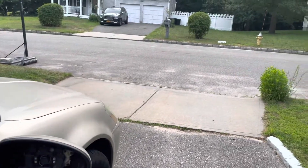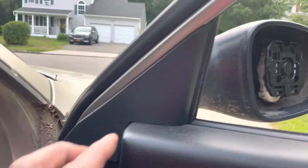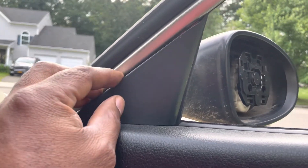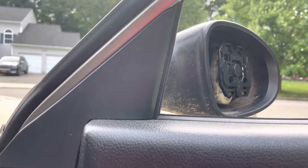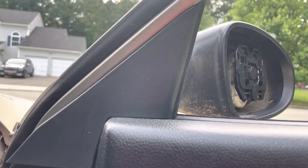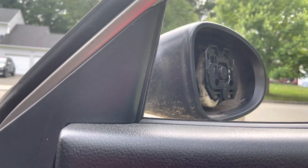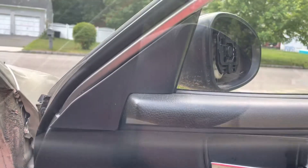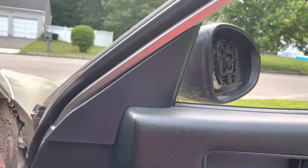You have to open the door fully. This triangle piece right here — you will use a flat-edge screwdriver to remove it. There are only three nuts holding up this side view mirror, so it's easy as one, two, three and you will save yourself some money.